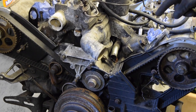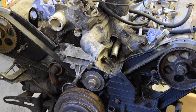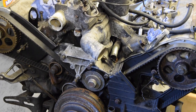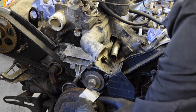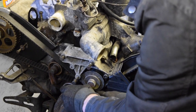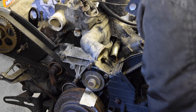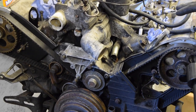From top dead center — which is where I think this is, so tell me if I'm wrong in the comments — cylinder one is at the top. What I'm going to do is rotate the crank around to about three o'clock, which I've been told is where all the valves will be furthest into the heads, as opposed to some valves being pushed fully out into the cylinders. It just makes taking the heads off a little bit easier. So I'm going to put a bit of tape on here like that — the bottom of the tape is the TDC marker. This one's roughly vertical, so if I rotate that round now so the top of the tape is roughly at three o'clock, hopefully that will work okay.